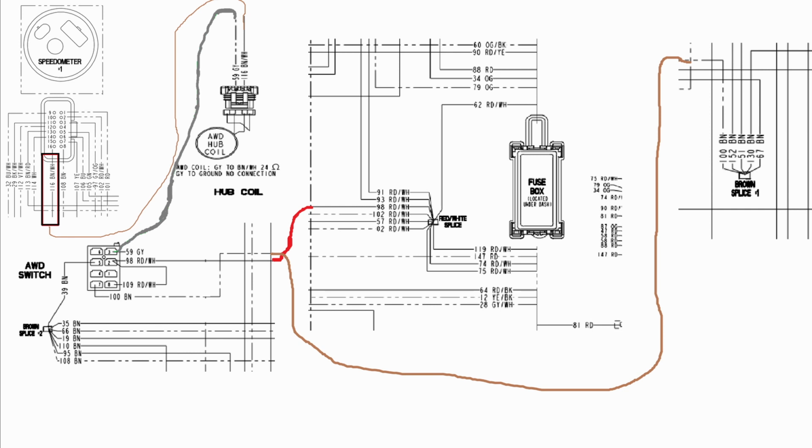Okay, so I decided to just post a wiring diagram. Some people online said that the all-wheel drive switch was grounded through the ECM or their computer. And in this wiring diagram, you can see that it is not. This is the condensed diagram, which only has the circuits that are relevant. I'll go ahead and put the entire wiring diagram in the description.